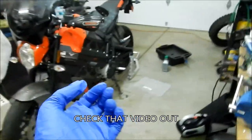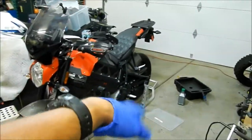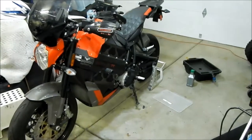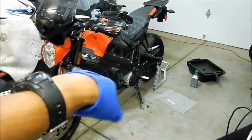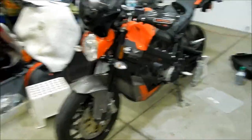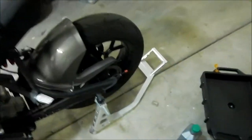What you want to do is warm up the engine and the gearbox by riding it — to lower the viscosity of the oil and to get the oil all over the place. It's been sitting for about an hour, so I want to rev it a little bit. I've already got it on the rear stand.